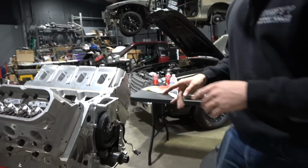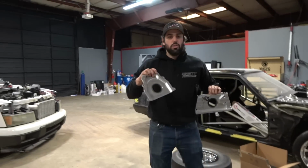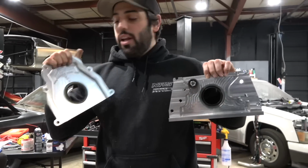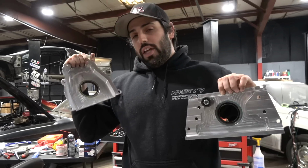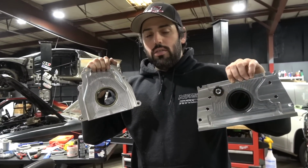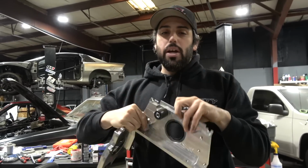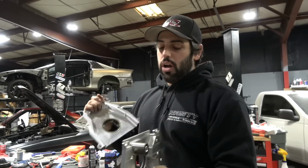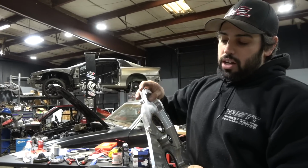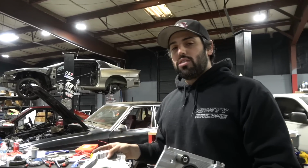The second thing is you got these two seals, which, let me grab this, I'll show you guys. These are your two seals, right? And as you can imagine, they need to stop oil from getting out of the engine. I would think it's very important to make sure whatever you have inside of there is perfectly centered, not off-center, where it's like smashing the seal on one side and leaving an opening on the other. And that's what would have happened if we were to just cram it in there. So there's a lot of due diligence on the installer's part to make sure they're doing things correctly.